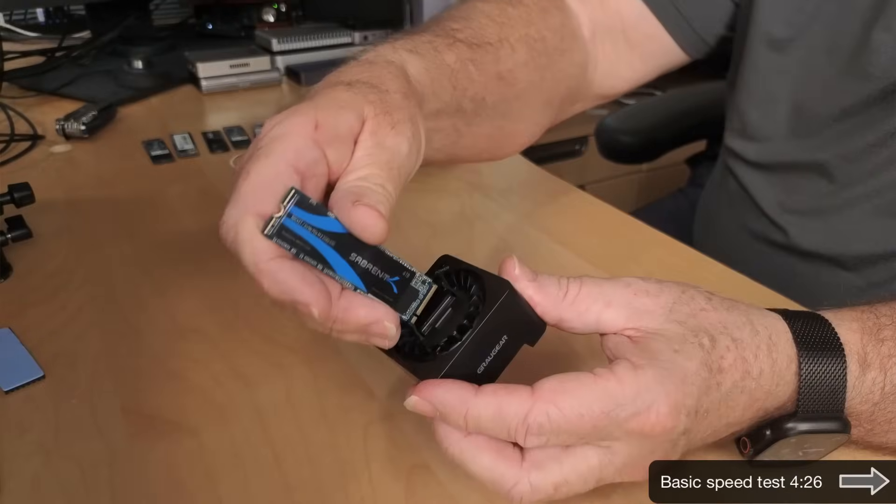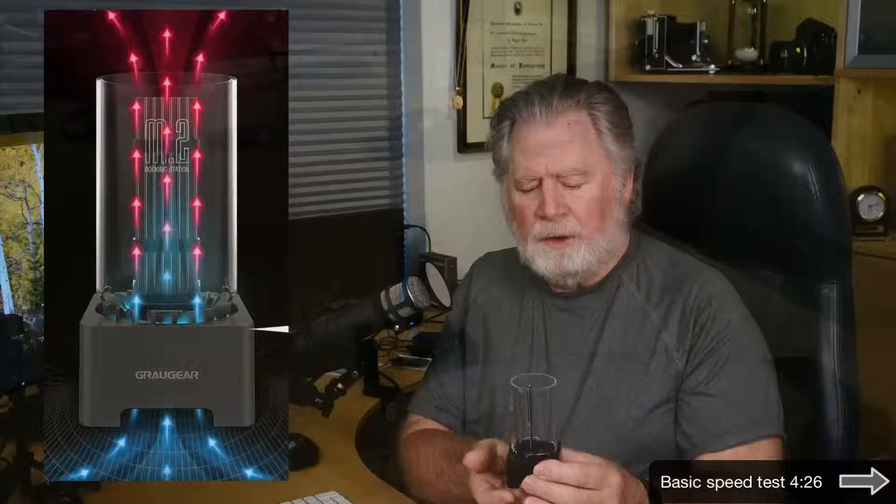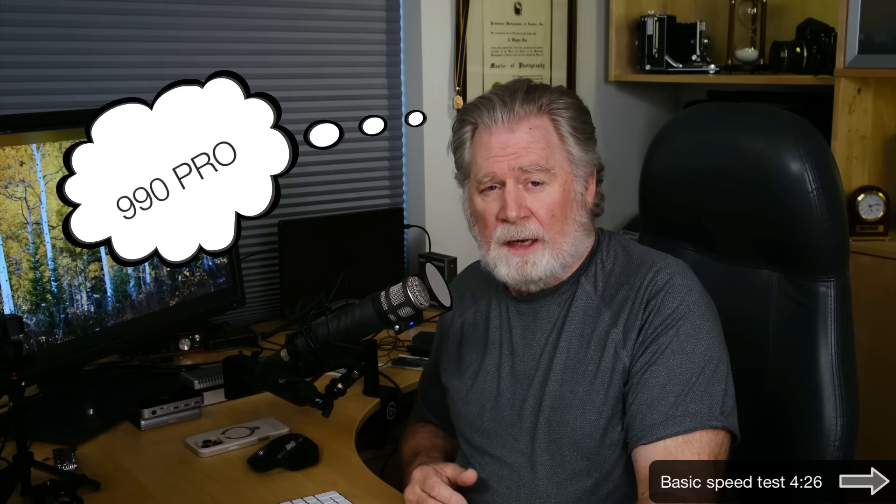It's a neat-looking little device. If you don't really need a portable one, it's a little cheaper than the portable ones. The whole idea is that you slide it between those two things, it pops into place, and you set your little tube on it. This directs the air from underneath and up through around the board and around the SSD to keep it cool. I'm not sure if it's adequate for a hot drive like the Western Digital or the 990, but the Evo Plus definitely won't have a problem without a heat sink. Let's run a bunch of tests — some speed tests and some thermal tests — based on heavy usage to see how important the heat sink is.